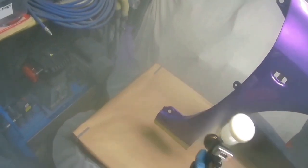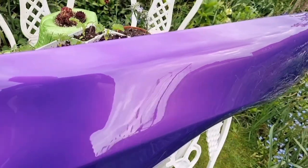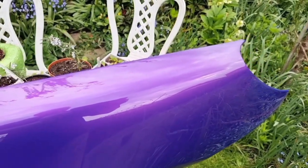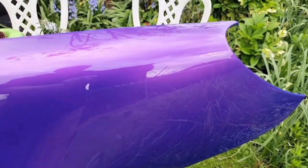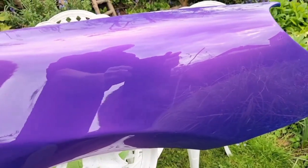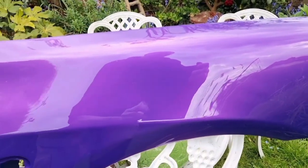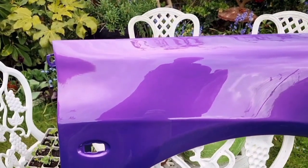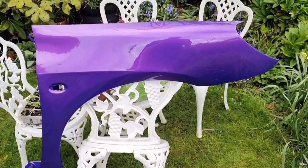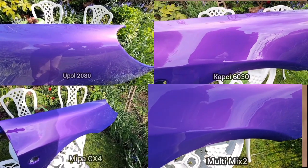Gloss levels are really really good - all these didn't drop much. Only the U-Pole drops a small amount with the fast hardener; with the extra fast it drops a lot more. UV qualities I'm still not sure about yet because it's relatively new to the market, but I'm sure it should be absolutely fine. These are all high solids clears so they're all comparable. Effectively it's like a three-quarter wet tack coat and then a full coat for your final gloss. It flows out really well with finer atomizing guns like the DV1. Highly recommended - this went from being my least liked to my most liked.